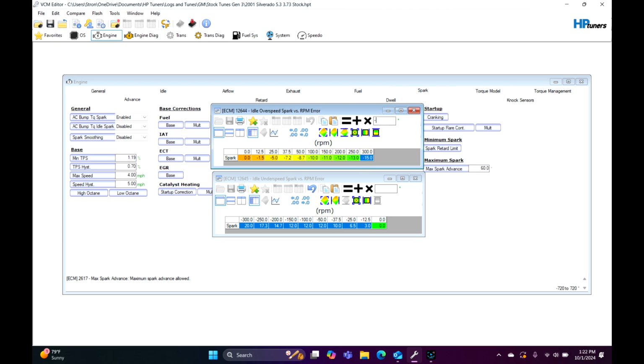So right here, we're just going to type in -20, and then we're going to equalize that, and then we are going to go to the 150 table. Oh, that'll work for me. It doesn't have to be even, but it'll get you pretty close right there. It's not really an important thing, but from a stalling perspective, it is pretty important to get these kind of right.